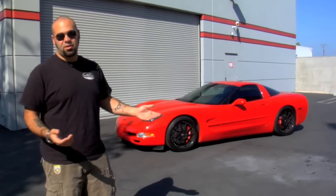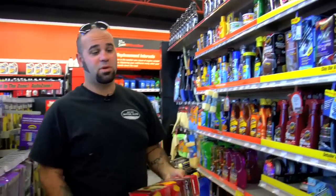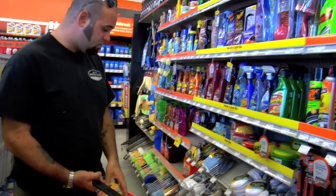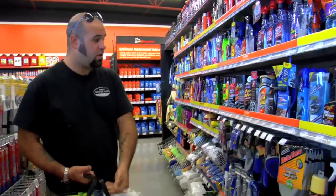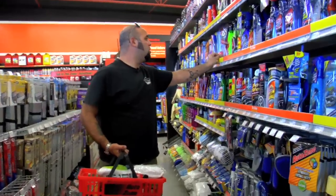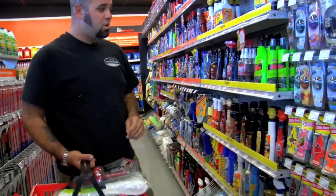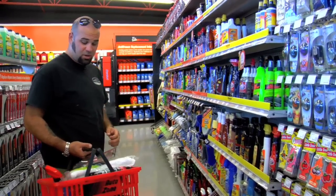Before we start cleaning this car, we're going to need some products. The Absorber — synthetic chamois. I like that one better than the real leather, and it's cheaper too. Wheel cleaner — definitely need some wheel cleaner; I'm going to take my wheels off and clean them. Clay bar kit — part of the one-two-three detail: clay bar, polish, and wax; that's definitely a must. Some applicator pads — get some extras. White towels to dry off the wheels. Aerosol tire wet spray — that's my fave. Black Magic bullet — that's going to clean the exhaust; it's a nice shape for buffing out the inside of my chrome exhaust. And protectant for the interior, which is a lovely shade of plastic. That should do it — let's get to work.